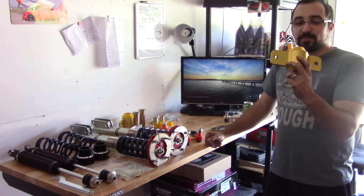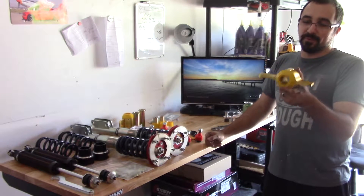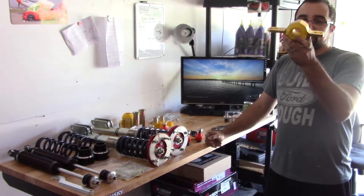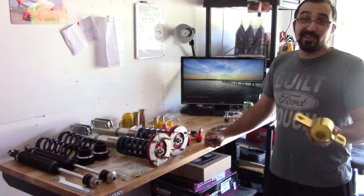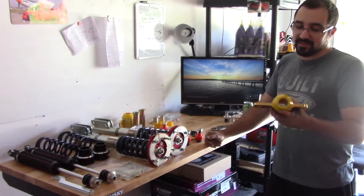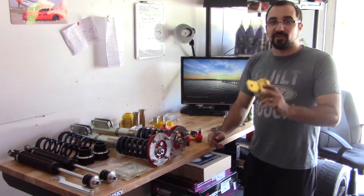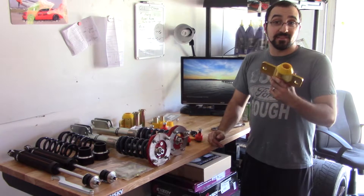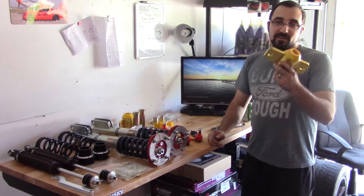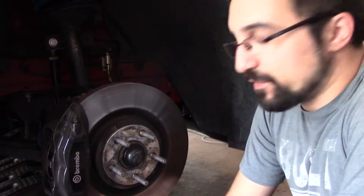What we're going to be doing today is an anti-dive kit. This replaces the front rear lower control arm bushing. The stock bushings have 52,000 miles on them and I'm running about 300 percent more traction than stock, so hopefully this will help reduce deflection with camber and caster. We're about to get the lower control arm off, take it to NAPA to have them press off the old bushing and press on the new one, then move on to the coilovers themselves.